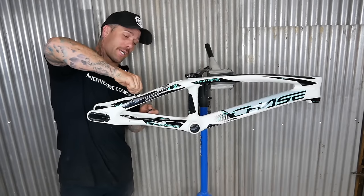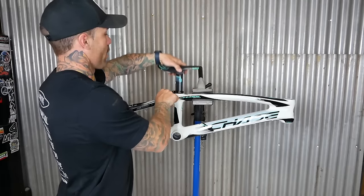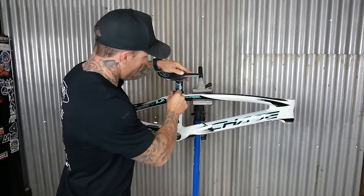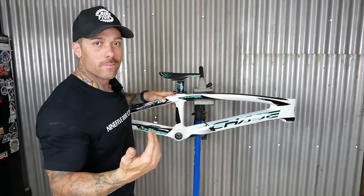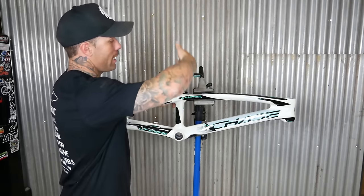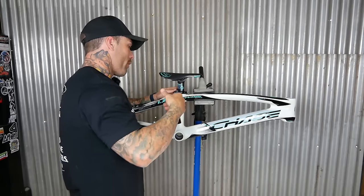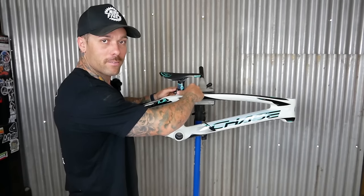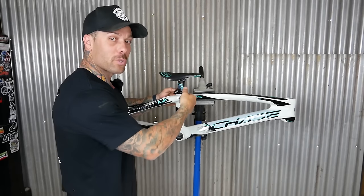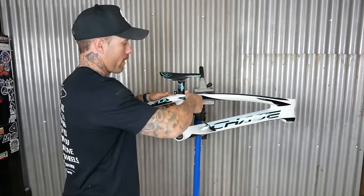With that being said, if you're building an ACT, I hope you're not putting V-brakes on it. Old seat versus new seat. Now I know someone's going to notice it — on the back of this seat post I have a little self-tap screw. That's because I don't run my seat bottomed out. I'm old — if I sit on the gate it hurts my knees with the seat all the way down, so I run it just enough to show the logo. That little stop allows, if I do slam — because you don't want to crank down on these carbon parts — so it just allows me to drop my seat down there and it's at the same spot every time.